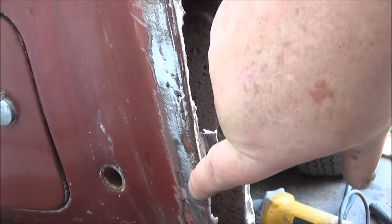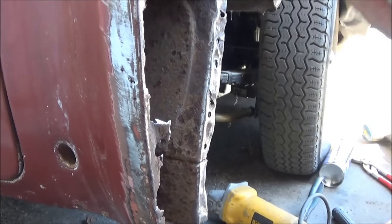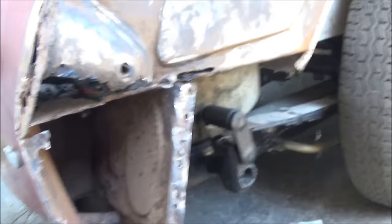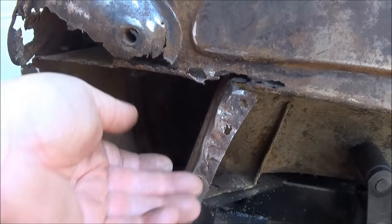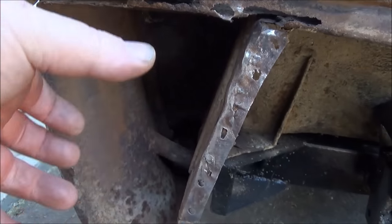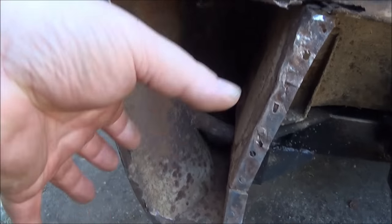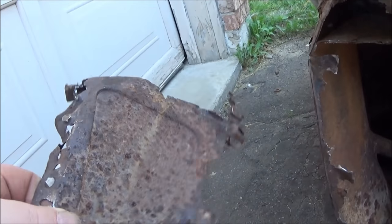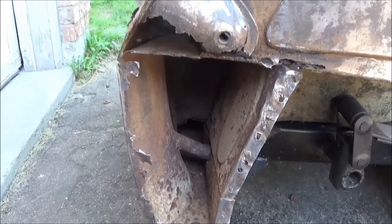We've got a bunch of pinholes here along the edge which we're going to have to fix up. We'll probably bring the repair back ahead of it and wrap around the edge, doing that in a couple of different sections — maybe halfway down to here and then finish the bottom half. Because of that slight curvature, I'd prefer to do that in sections. This closeout panel here is not bad actually. I'm going to drill or fill all the holes with weld, and I actually have a spot welder. This is the budget build, so we may just make a triangular-style closing plate with the cage nuts on the inside as you see here.